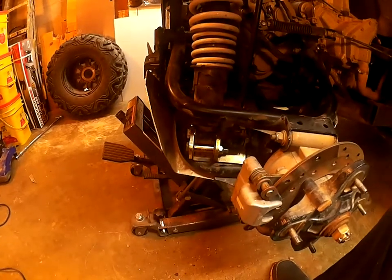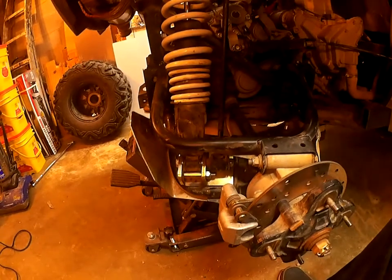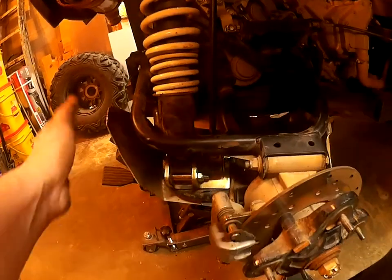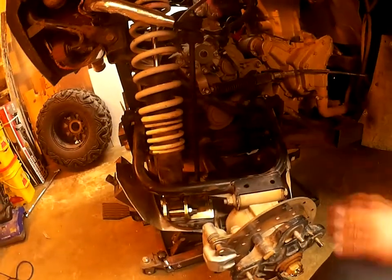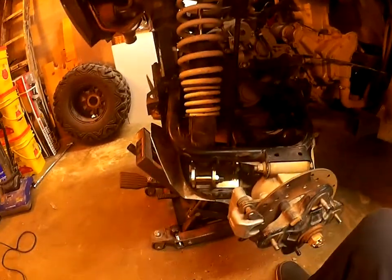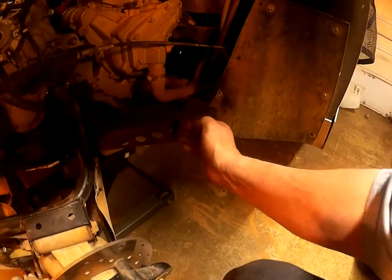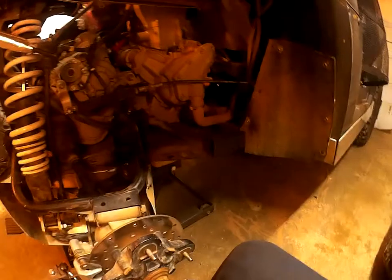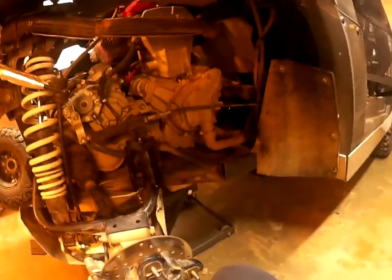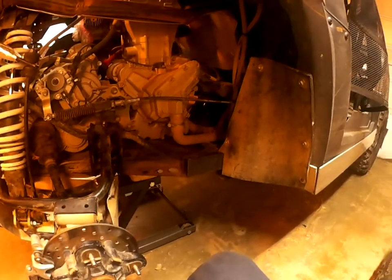Of course it went just fine for me. The two-inch lift kit was a go — got it on, it's ready to go. The only problematic thing I ran into was my a-arm guards, which had to be somewhat manipulated on the hasty side. And of course trimming this piece of steel here, because my tire was coming right up against it right about here. So that's my two-inch High Lifter lift kit project part two — that's my story and I'm sticking with it.